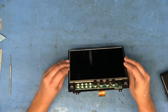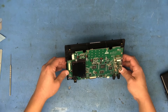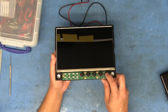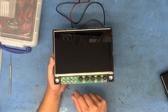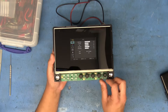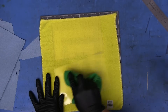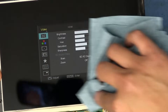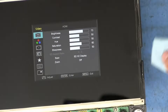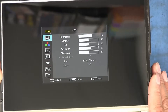We can put it back into the frame, connect it back up, and see how it looks. I haven't put any tape around the edges yet — I just have it held in with the clips it already had. I'm going to apply 12 volts to the connector here rather than using the original power supply. I've got power going into it — hitting the power switch — it turned green so it should come on, and there it is. It's not going to show anything because there's no video input, but let's hit the menu. Hey, that's looking pretty good! In the garage it's nowhere near clean room condition, but I was using microfiber cloths to clean everything after cutting. It all looks pretty good.